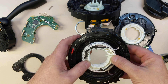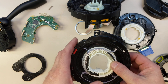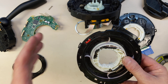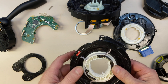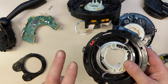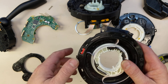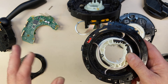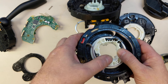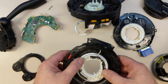This is what's called a clock spring. Back in the early days of cars, when the only thing you had on the steering wheel was a horn, they would typically have a slip ring — a small circle of brass with a brush rubbing it to electrically conduct the horn signal. Nowadays, we have a lot more controls on the steering wheel and airbags. The airbags have two stages, so two squibs, and then a deflator squib, so three squibs — and that's why there are six connections here. You can't trust those to a slip ring. If the slip ring was dirty or couldn't carry the current, they wanted to make sure it was wired. So basically they have a continuous wire that goes all the way from the airbag out to this connector and then toward the restraint control module that fires the airbags.